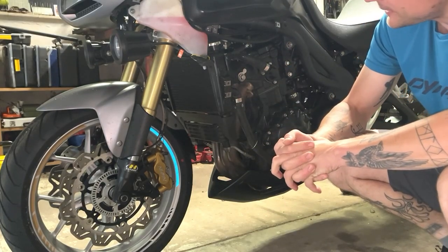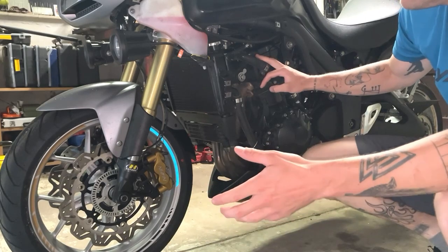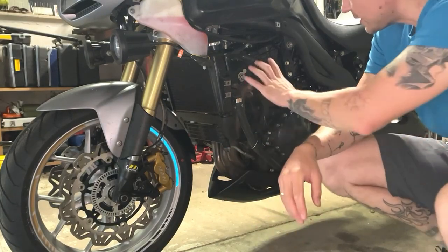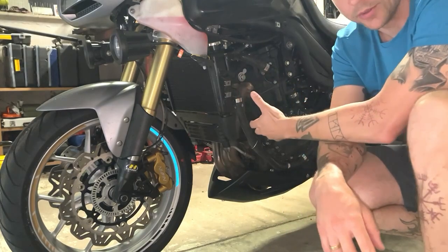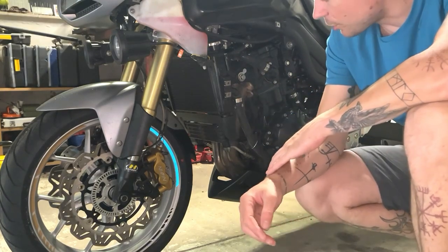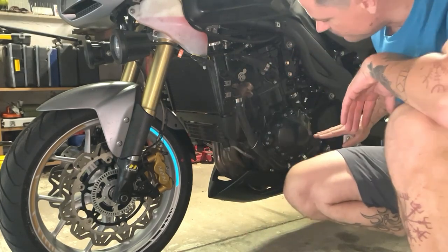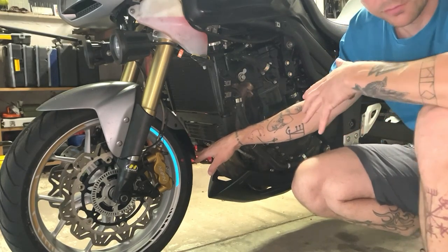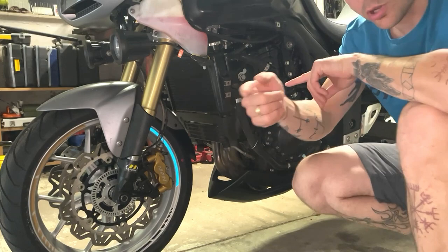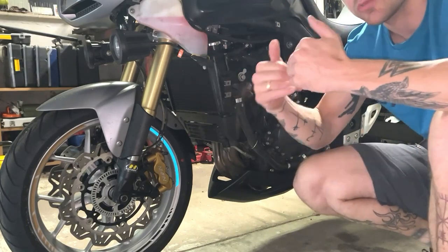So basically what you see on the Tiger is we have air cooling, like most bikes have. Only sport bikes with a lot of cover have less, but still there's always some sort of air cooling. This one has air cooling because the engine is open. Still, the bike is equipped with very good additional cooling, like the oil cooler you can see here, which is just part of the oil channel system. The oil pump makes sure that the oil goes through all the channels and gets cooled via this one. It's just a radiator with channels where the oil passes, wind comes in, and that's it.